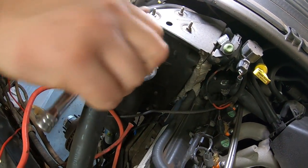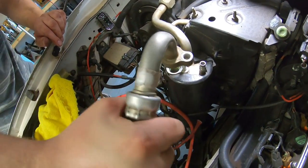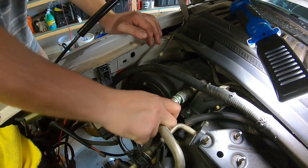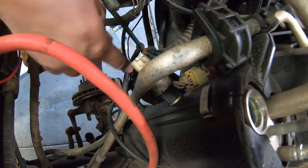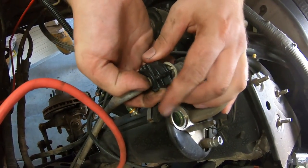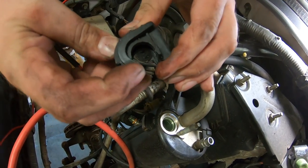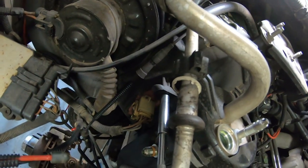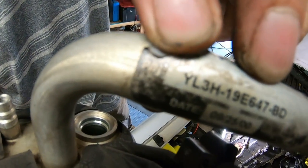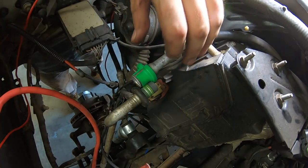Now the filter dryer. Take the top line set off — it's just a nut — and pull the line out and tuck it aside. This line runs from the evaporator to the dryer. A couple of adjustable wrenches will work fine. Unscrew the low-pressure switch — you might need channel locks to get it started, but don't forget it for later. Two levers on the dryer just pop right off. Then unmount the dryer from the evaporator box: three bolts, two on the engine side, one on the other side, plus a rubber grommet. This was the original dryer — the date code was from 2000.